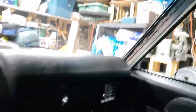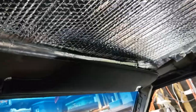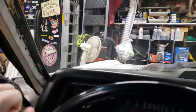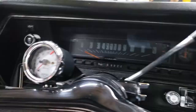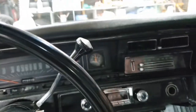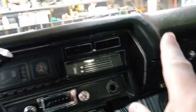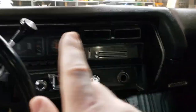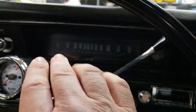You will need to remove your A-pillar trim. Mine hasn't been on in a long time — this car's a work in progress. It's easy enough though: two screws each side and the A-pillar trim comes off. Then you've got to take the dash pad off, which really isn't that hard either. All my screws are already out because this car was my late brother's, and the screws were already out when I received it since he was in the middle of working on it himself.